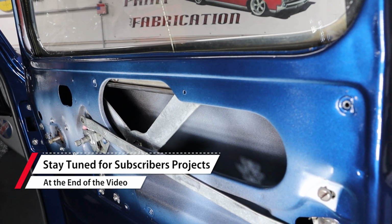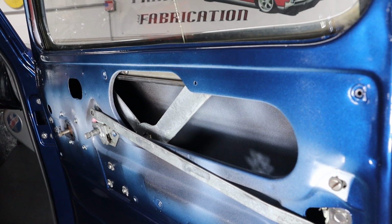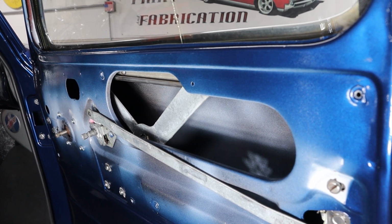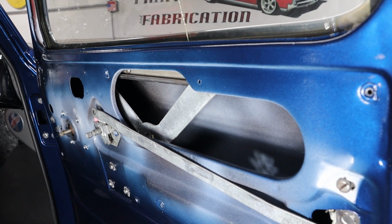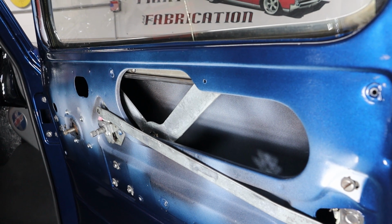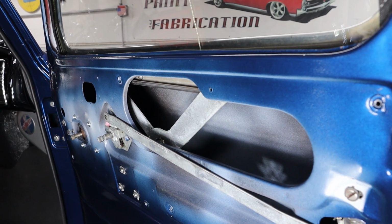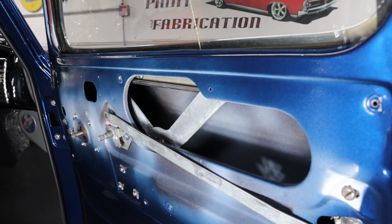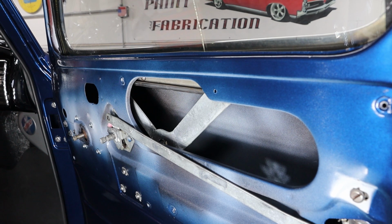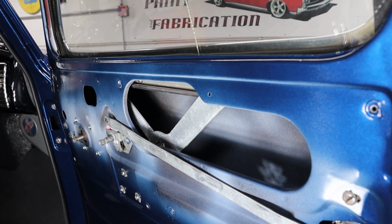I bought a 5-pack at the store. I use 0.7 mil drop cloths, the plastic ones. Don't get the super thin ones, they're just aggravating. Spring for the extra couple of bucks and get one that's a little bit thicker. The 0.7 mil is thin enough so you don't have to worry about it scratching or being hard to handle, but it's thick enough so it doesn't tear and fall apart on you really easily. So let me get some drop cloths on this thing, and then we can get to work on it.